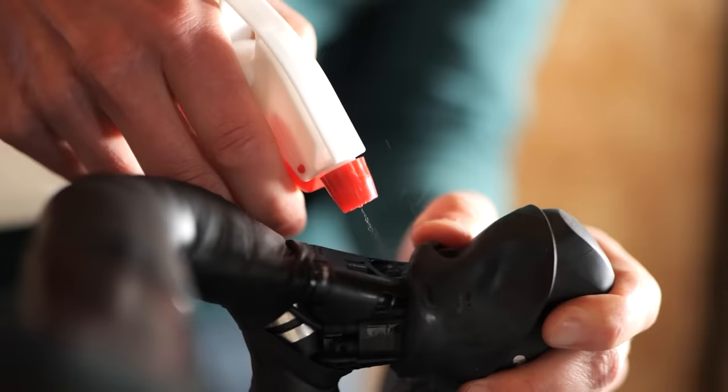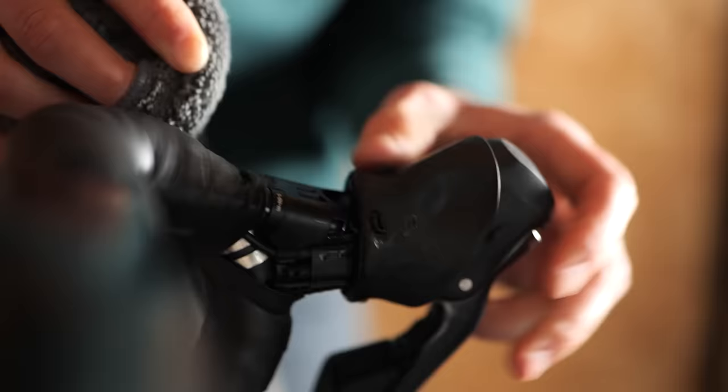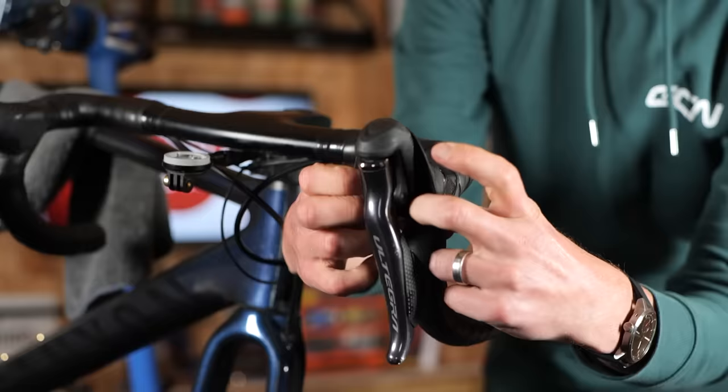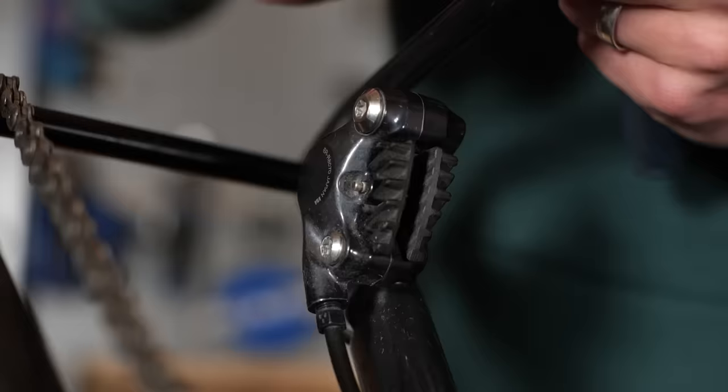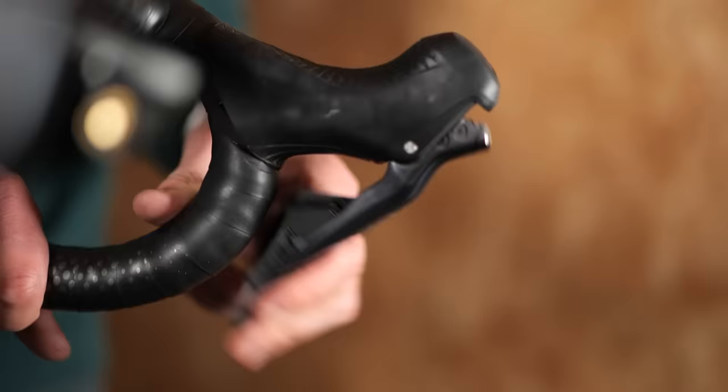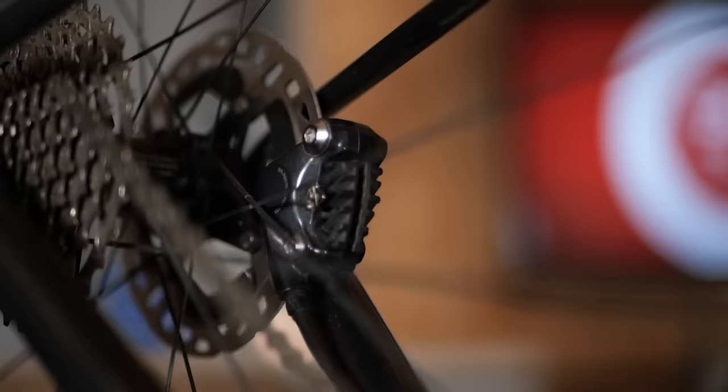Replace the small cover on the lever port and use alcohol, disc brake cleaner, and your cloth to wipe up any mess at the caliper and up at the lever. It's also important to make sure not to overtighten the screw — Shimano simply recommends less than one Newton meter here. You can then pull the rubber hood cover back into place. Refit your brake pads followed by the wheels, before pulling the brake lever on and off a few times to allow the brakes to self-adjust and double check they work okay.